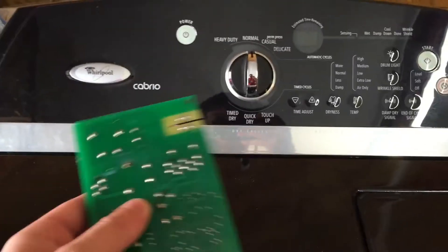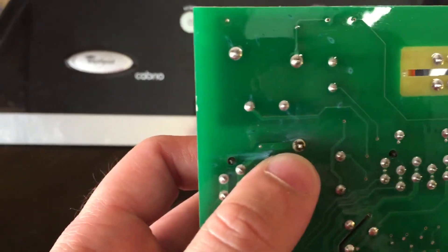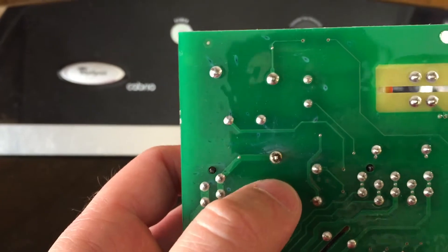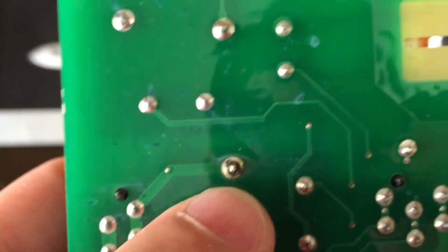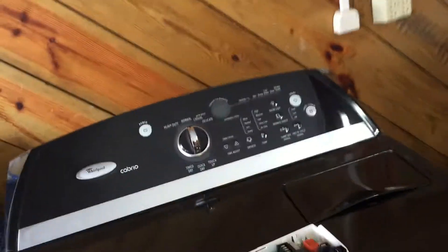This is not a cheap control. What I found was — I took the board out of the housing, and on the control itself you can see right here one of the solder joints has broken loose. There was a little bit of residue on the board before I wiped it off, but you can see one of the solder joints is broken loose, and I'm assuming that caused the whole problem. You can also see a little bit of burning on the back of the casing.